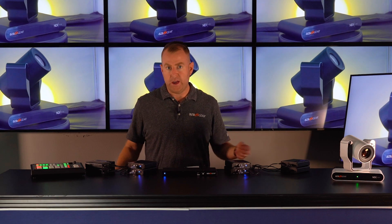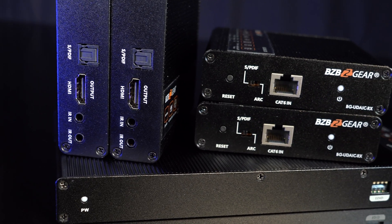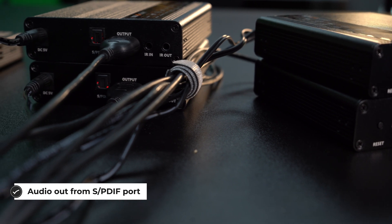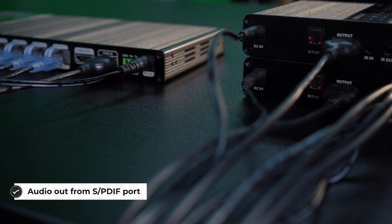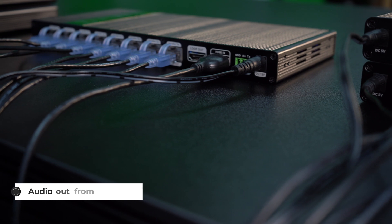Each receiver is actually equipped with a lot. All of them have the HDMI out going to your displays. They connect to the transmitter through cat 6 cable — or cat 6a or 7. You do have to plug them in with power, so they're all running off a power supply. For audio, you can extract through the digital audio out, and also each unit supports ARC — the audio return channel — if you're looking for that from your devices.